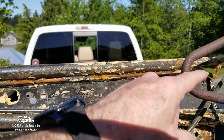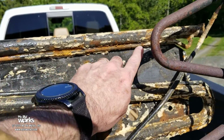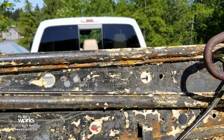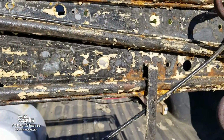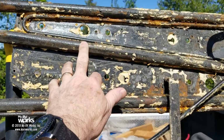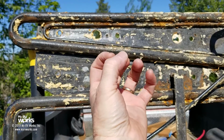And so wasn't the ammonia pretty hot coming into here? The ammonia was pretty hot. And so we bring that ammonia along these tubes here to pre-cool it, if you will, okay? And by the time we get to here, it's pre-cooled, and then all of a sudden it vaporizes. And as soon as it vaporizes, bam, we have that immediate cooling reaction because of the vaporization effect. Now we have this large tube going around and around, and this is your low temperature evaporator. Why do we call it the evaporator? Because that's where all of the ammonia is evaporating. And as it evaporates is where we have absorption of heat. In that environment, that heat is being absorbed in that ammonia.